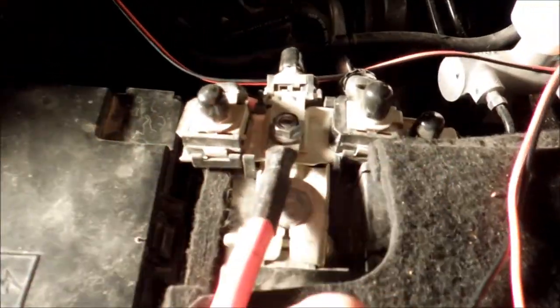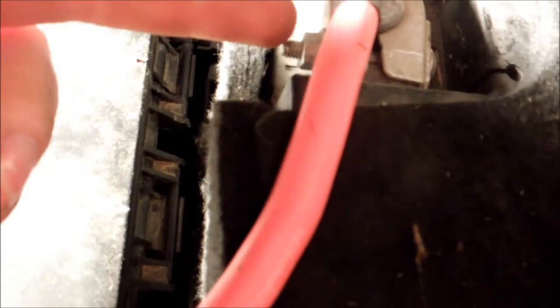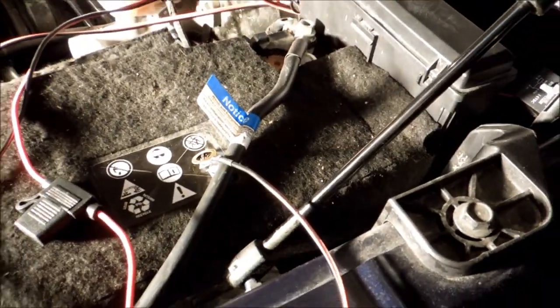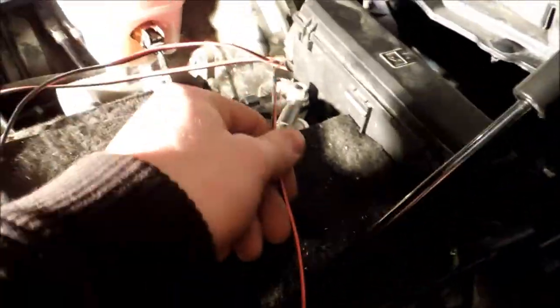And then the fused one — well, you've got a whole lot of choices on the Ram. But if you don't have a Ram, see how this has a side post right here? Almost 90% of cars is going to have one. You can loosen that right off, take your positive, and put it in there. If you have a side post on your negative as well, put that there too. If you don't want to do that, just find a good piece of metal to ground to, or go right off the fuse box, or best of all, go right off the ground on the battery.